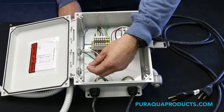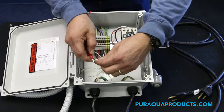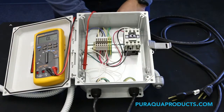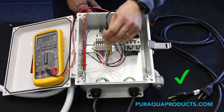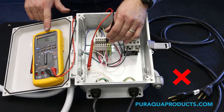Step 3. Remove one of the level switch's wires and connect to one of the meter's probes. Step 4. Connect the meter's other probe to the level switch's other wiring. If the switch is good, you will receive a reading of zero. If not, proceed to the next step and begin with removal of the switch.